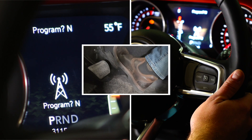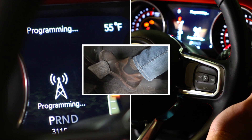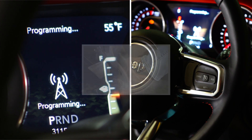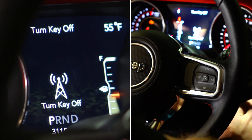No press on the accelerator is no, a full press is yes. I do want to go ahead and do that, and you'll hit your set plus button. You'll see here that this will take approximately 10 seconds — it's very quick. It's saving all those settings into the vehicle so your speedo is corrected, your shift patterns are going to be accounted for with your aftermarket gears, and obviously you'll still have your power levels on top of this. Now we can turn the key off and we're ready to go.